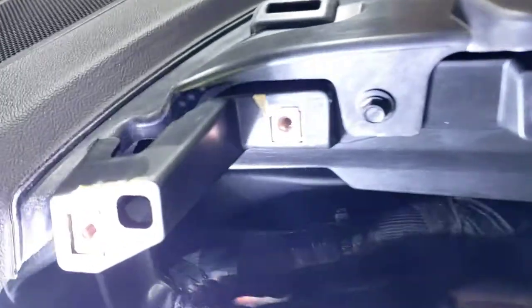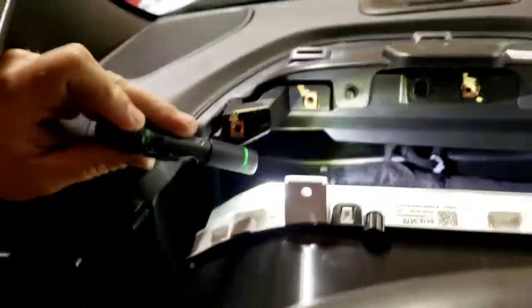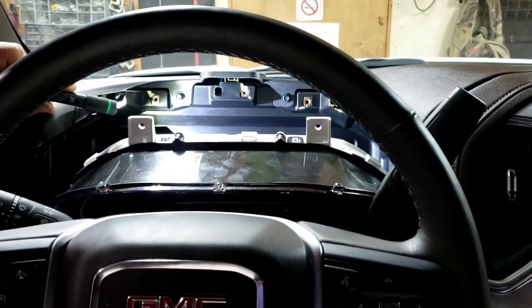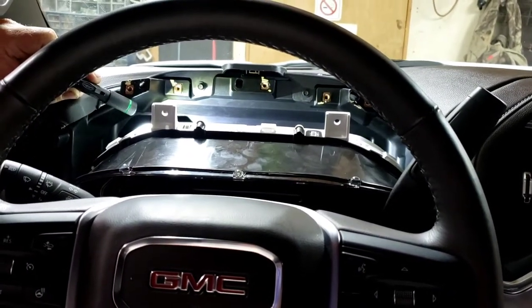All right, so we're trying to get to these joint connectors. But if you look, the joint connector is actually in this harness here, which is kind of a pain in the butt to get to because you have to open the harness up. But not only that, all those wires are soldered together. It's not like a splice pack on another GM where you take a connector out. We literally have to cut those wires, and I don't want to do that or desolder them. So we're going to go to a next approach.